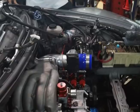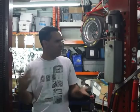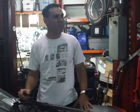Yeah, 300 to the wheels is the problem with the original engine. It doesn't work in any condition. You can leave it stock; it's got a problem. You could put a little exhaust on it, and you're going to develop a problem sooner. You could overhaul it, and you just flip the hourglass. Then what? It's still a piece of garbage with no nuts. And they're expensive as hell to do all of the above compared to the previous ones, because the rebuild on these requires a lot of parts. $5,000 to $10,000. The side housings, you can hardly ever resurface them.